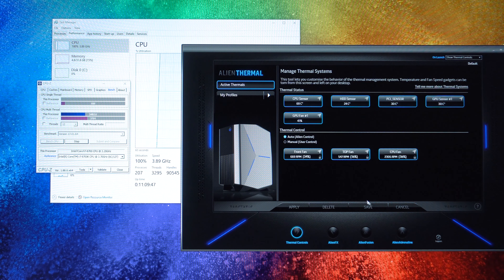From my experience upgrading to a liquid cool system, it has a lower noise level than air fans. Also, because the inside of this case is very narrow and tight, it's not great for air coolers that blow air inside the case — we're basically trapping heat inside. The Alienware Aurora is designed to use a water cool system; the cheaper versions just use air coolers. From my testing, the liquid cool system dropped CPU temperatures by an average of about 10 degrees Celsius, and sometimes up to 15 degrees. Under extreme conditions — gaming and heavy tasks — the difference can be up to 20 degrees Celsius compared to the original air cooler.